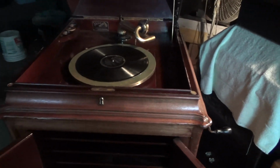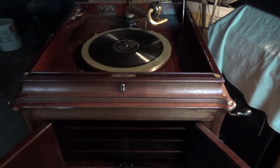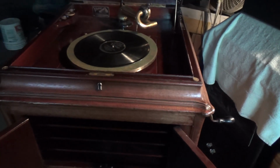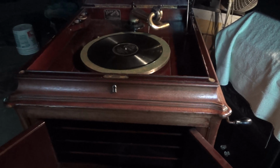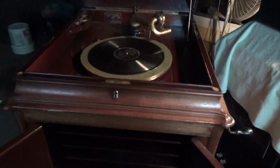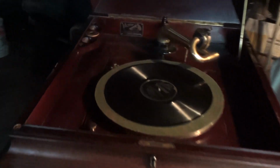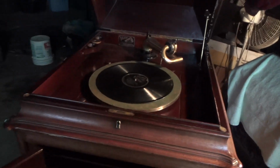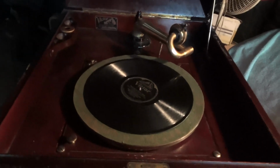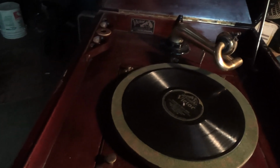Immediately. Let's see. Motor's in nice shape. Give it that much. Three nice springs in there. Really weren't even that dirty. Yeah, the grease was a little dry, but still greasy, I guess you could say. I did have to replace the friction leather, and now, as you can see, the knob is properly where it should be. Well, it doesn't really have a place to be, but it was screwed all the way down, and there's no way you can get an adjustment properly with the knob completely screwed down. It's just not going to work.